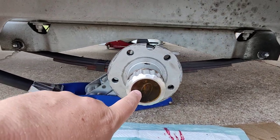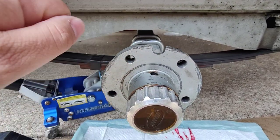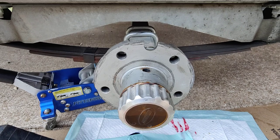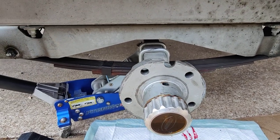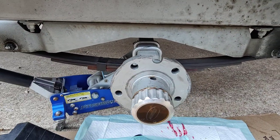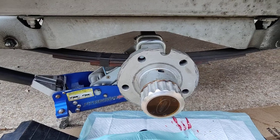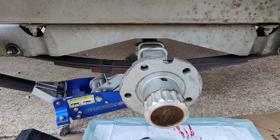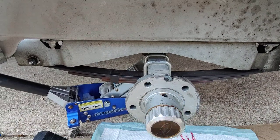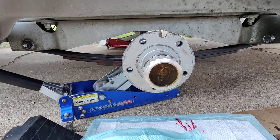The trick of how I filled it is basically to fill it with that hub oil until it can't fill any more — it'll basically bubble up and then you'll get an air bubble, and then it's basically good to go. It'll fill it just below half. Then I waited about an hour for it to settle. Keep in mind it's like 70 or 80 degrees out here, so it's not cold. It's basically kind of gear oil — 80-90 weight — and it moves super slow. I filled it until I couldn't fill it anymore, waited about an hour, it settled, looked at where it was, and then I put literally five seconds more fluid in it. And that's where you get to where I am right now.